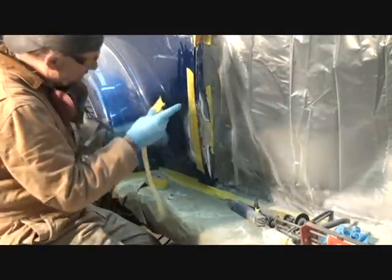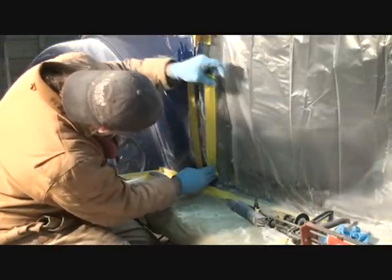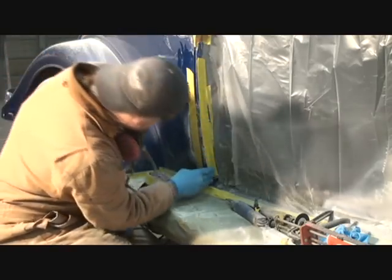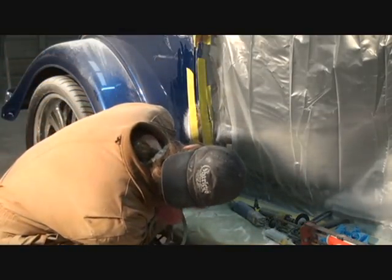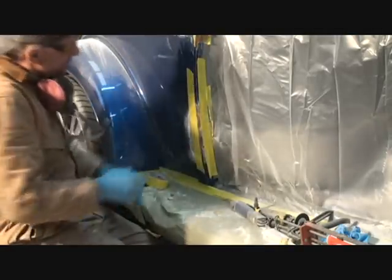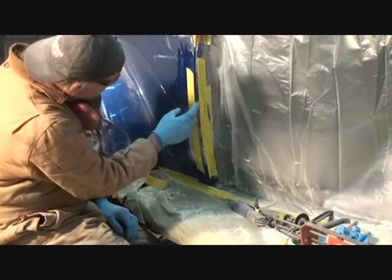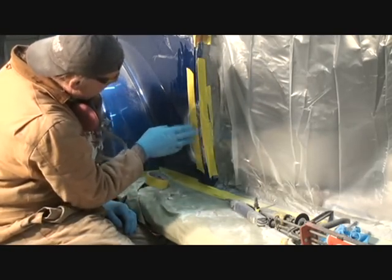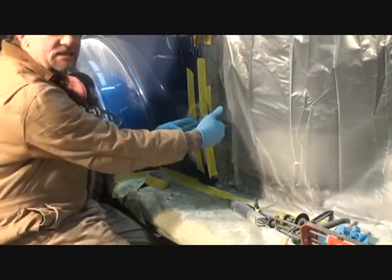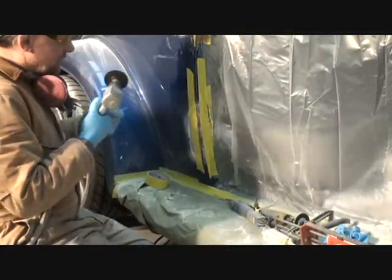Then I'm going to come over here and get one more — I'm going to put in this, it's kind of a curve, because the door does have a curve to it like this. So I followed that body line on the inside here and here. Now what I gotta do is cut this out, sand it down this way and that way to make that opening. I'm going to go ahead and use my little grinder to do that.